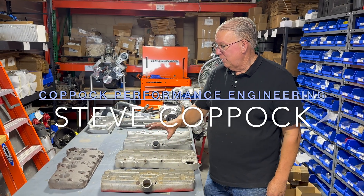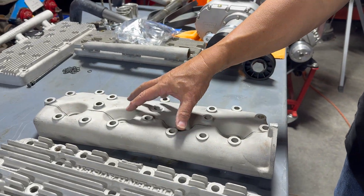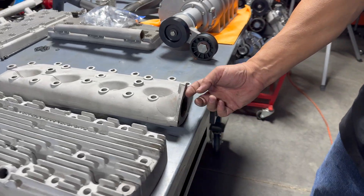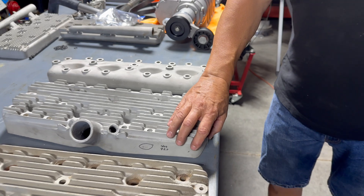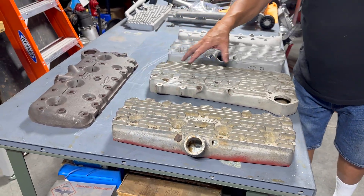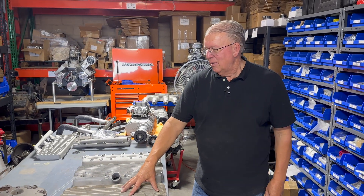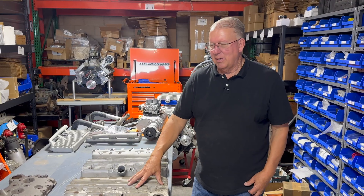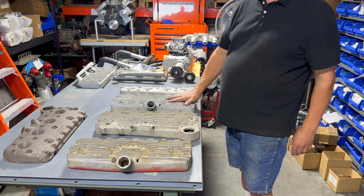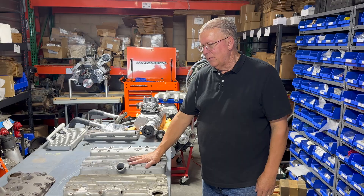They're different. I have everything from an early 21-stud Ford head here — those had the water pumps up on the front of the head. And then I have a couple of examples of the 8BA, so 49 to 53, but technically there were truck engines in 48, so I'm going to say 8BA-style heads. And then I have two 24-stud heads here, so that would be what we've called Series 2 or Type 2 cylinder heads.